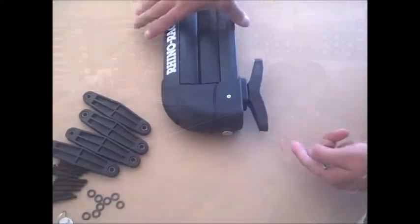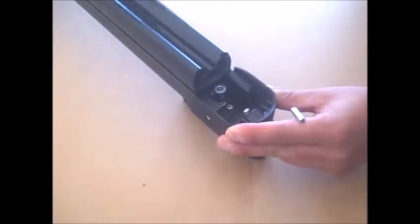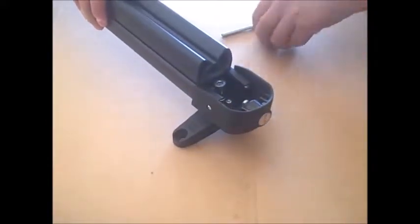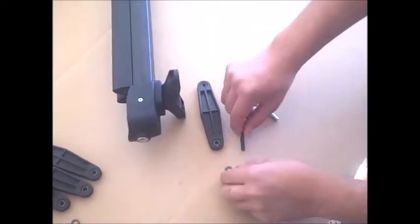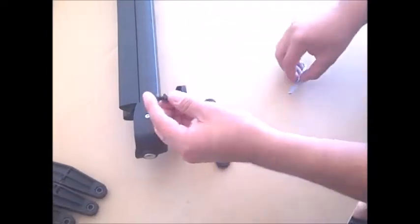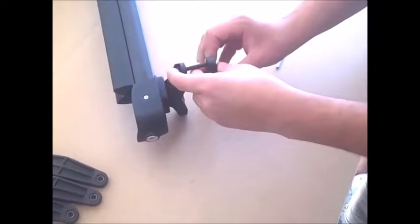The first step is to loosen the barrel nuts on the pre-installed hardware and rotate them so the mounting brackets are ready to sit on top of your crossbar. With all 4 brackets in place, you can finish pre-assembling by loosely fastening one half of the bottom mounting bracket to the top half. Be sure to use a washer when threading the security Allen bolt through the top half of the mounting bracket, then tighten the bolt a few turns through the bottom half.